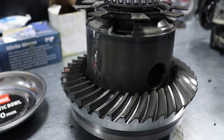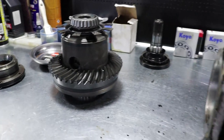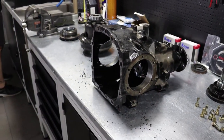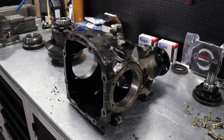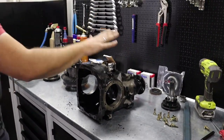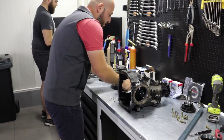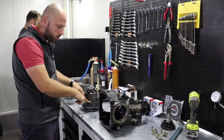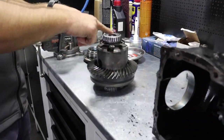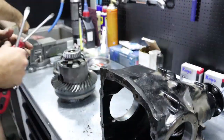We won't be touching it in this video. If you have any questions regarding assembly of the differential of the LSD unit, then please write us an email or leave a comment and we will do a video for you. But in this video we will focus on the gear ratio swap, not on the LSD unit itself. But you need to remove the crown gear. To remove the crown gear, you need to remove this speed sensor. So I will do that right now, sorry.